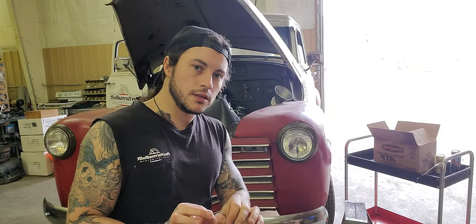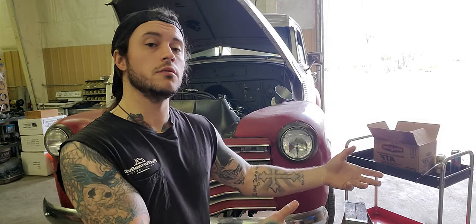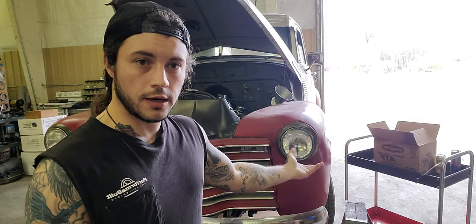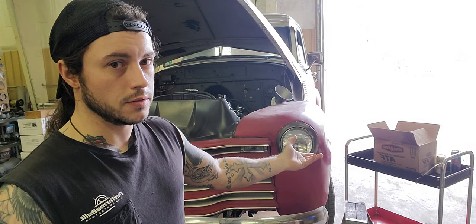We are expecting, this is everybody, not just me, anywhere from 9 to 14 quarts. It doesn't matter what vehicle you have or your setup. If you have changed anything, or even if it's bone stock and you've bought a transmission or somebody else's, expect 9 to 14. There is no set number and you have to check your stick. It's better to have a case of fluid than only a few quarts and run out midway through the fill-up.